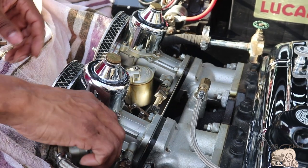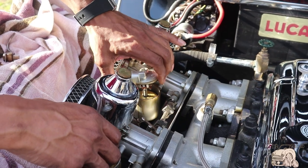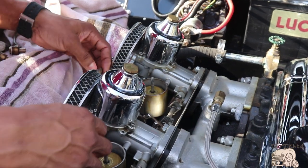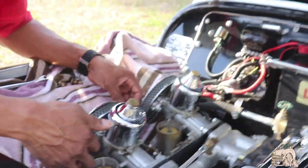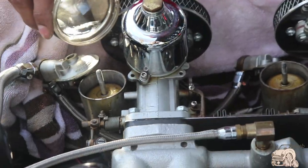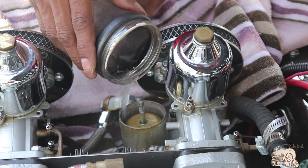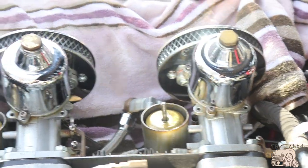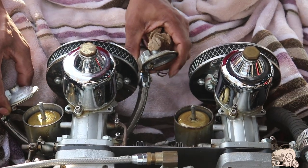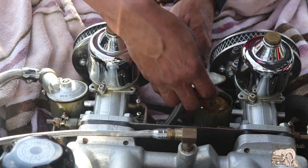I'm sure a lot of you mechanic guys already knew this, but I'm not a mechanic. You can see I'm getting fuel — my jets are open now. If I close it, it shuts off. Same thing with this one, so my jets are working. Just take a little cup of gas, fill it up till that bowl comes to the top, till your float comes to the top. That's going to buy you maybe a mile down the road. You see that float still leaking gas? That's telling me there's nothing wrong with my needles.